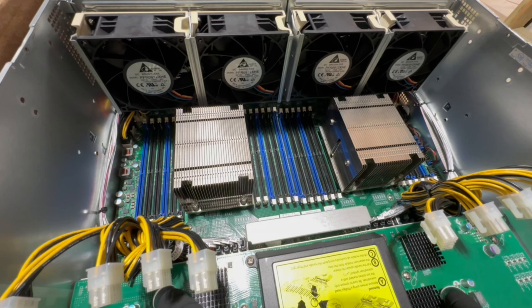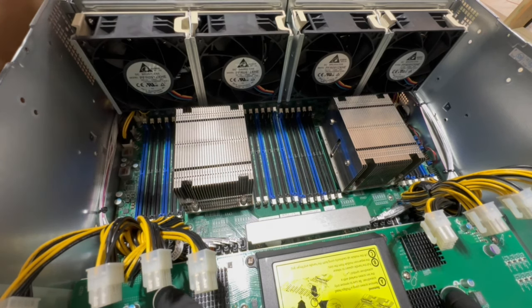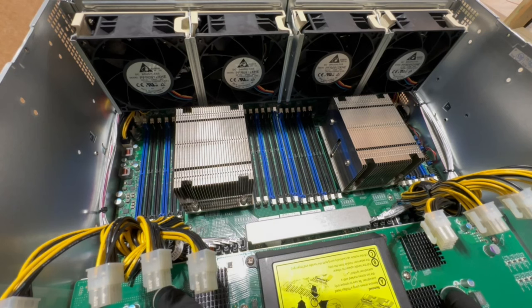So what we're going to do is take one kit and split it. Each module in the first kit, we're going to split between A1, B1, and then go C1, D1, and so on all the way up. And then we'll basically break each kit across the consecutive memory channels and the same number. So A1, B1, C1, D1, etc. So that's what we're going to do. And I'll just go ahead and show the first one here, our first couple, and then I'll fast forward through it.